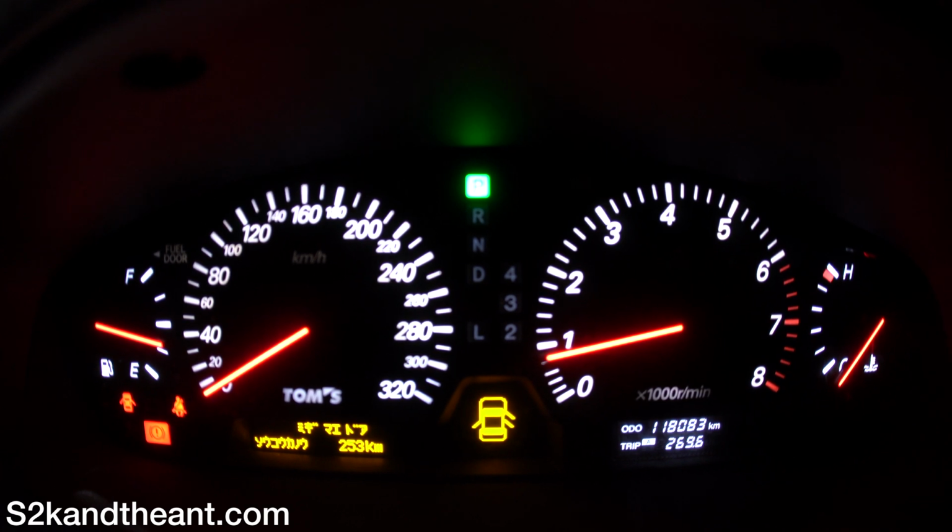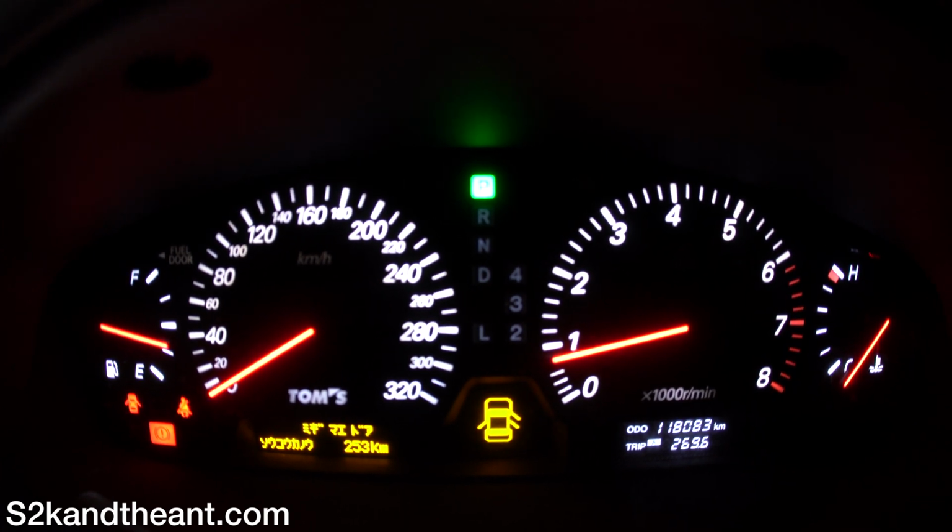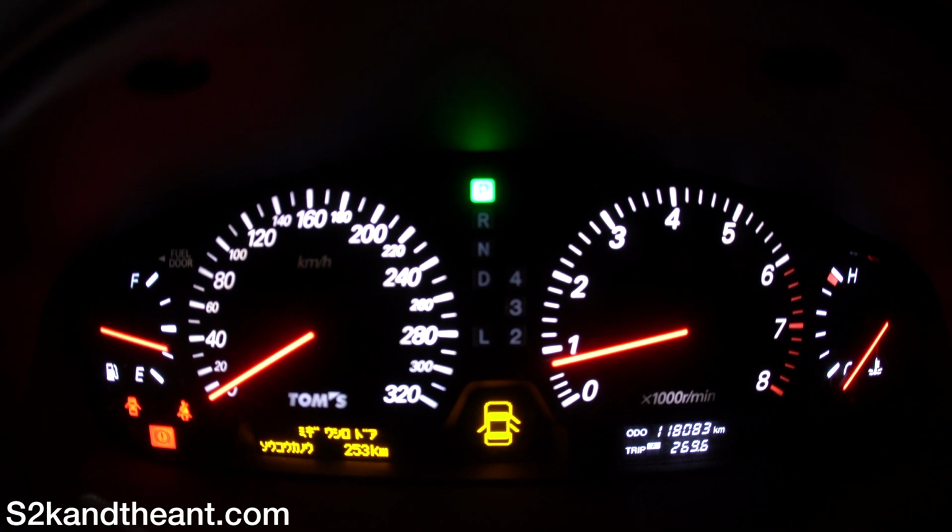It was the fuel pump that went bad. Yeah, oh my god, I'm so happy because I need to turn this off because the garage door is closed. Basically what happened was, sorry, the thing beeping is my battery jumper. Basically what happened was, it was periodically just dying. Every day it was getting worse and worse until one day it wouldn't even start anymore. It would just crank over and just die, fall flat on its face. So I thought it was the ECU, I thought it was a bunch of other crap, but it turns out it's the fuel pump, and that's how you replace it.